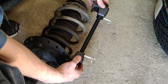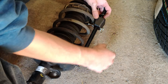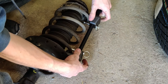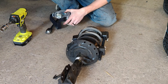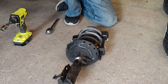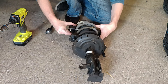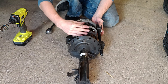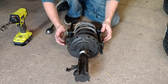Now, I'm not a trained professional mechanic, and the steps I'm about to show you may not be the best way to remove your springs, but you can get spring compressors from your local auto parts store easily. As long as you are cautious and follow safety steps, this is a quick and cheap way to get your springs compressed and remove your top hat hardware. There are two very important things to keep in mind: number one is eye protection — better safe than sorry. And two, clamp down little bits at a time on both sides. You don't want a spring getting squished on one side and not the other, as one could slip and fly off.